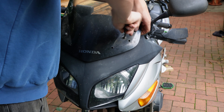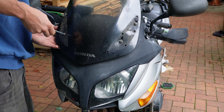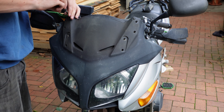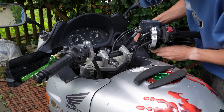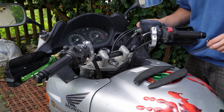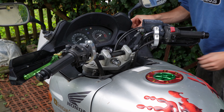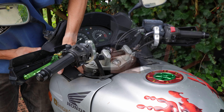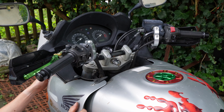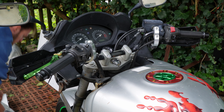To gain full access to the light's back side you want to start with removing the windshield. Be careful while removing parts — if something is fighting back you need to stop and look for the pin or tab that is still connected, otherwise you will break stuff. Like here: I forgot a connecting screw that was hidden under the side panels. Too much force and it would have broken.